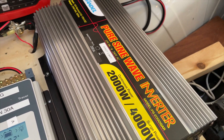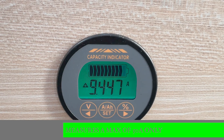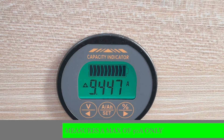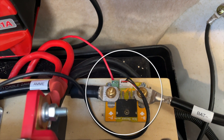But like any system, there's going to be an exception. This will measure all of my power usage as well as charging, but it leaves out the power usage of my inverter. The reason for that is the only safe and right way of setting up an inverter is connecting it directly to your batteries. Don't try to measure the amount of current you're using with your inverters, because they use so much power that if you needed to buy an ammeter to measure that kind of voltage, it'd be big dollars. This is a very effective method — it doesn't cost much, it's available online for a few dollars, and it's easy to set up. All you have to do is make sure that the part of it that reads voltage sits at the very end of your negative pole of your batteries, so all your devices come through that, and you'll be able to measure energy flow in and out.